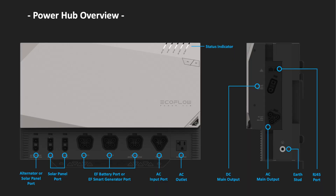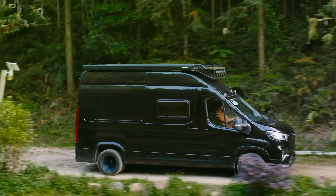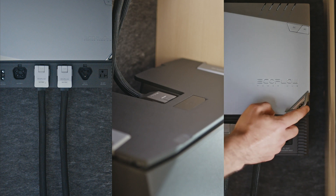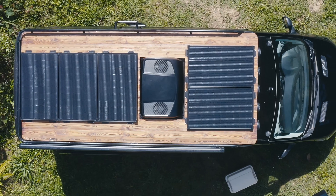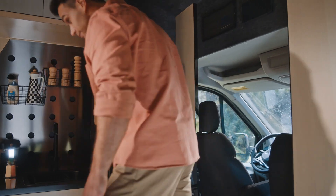You can turn off all the AC circuits with one click of a button, and the same for all DC circuits. On the front of the Power Hub itself there's an AC and DC button so you can turn them off directly. Installing this system is really simple — first you mount the Power Hub, then you install the batteries. There are three inputs: one cable runs forward to your starter battery, two inputs for the MPPT controllers for solar panels — one for roof panels and one for panels you stand outside the van — and there's an input for shore power that goes to the side of your vehicle.